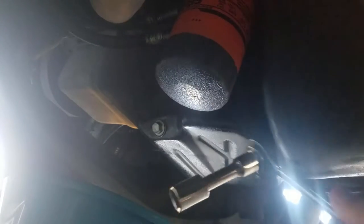The next step is you want to find your sump plug, which is this guy right here, and you're going to loosen that off. That's where all the main oil from the sump is going to come from. Once we get that off and drain the oil, we'll proceed to take the filter off. You're going to need a wrench, and the size for the Chevy sump plug is a 9/16ths. So go ahead and loosen this off to drain the oil.